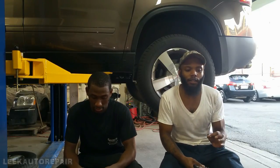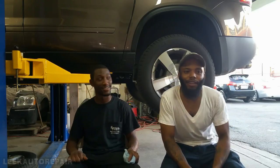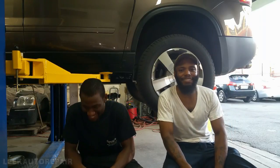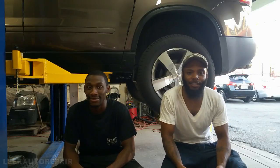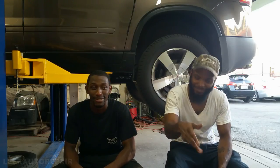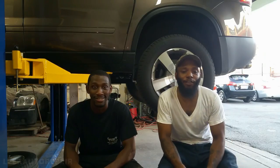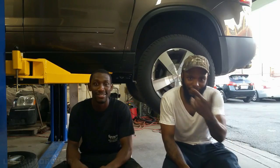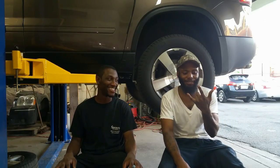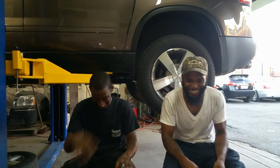This is Young Whippersnapper right here — he assisted. I assisted him on the job showing you how to replace the CV boot, the outer boot, or the left front axle boot on the 2010 GMC Acadia. The skill set level on this job — a C-TEC can do it, it's really easy. The hardest part is probably getting the outer joint off the shaft because sometimes there's a locking ring you have to remove first and you really have to hammer on it, but this one came off fine. We got the job done. I'm Leak Auto Repair — if you guys like this video, make sure you hit the like button and subscribe. Peace.